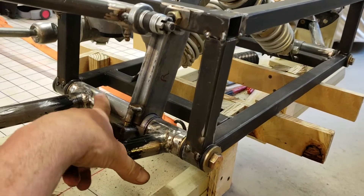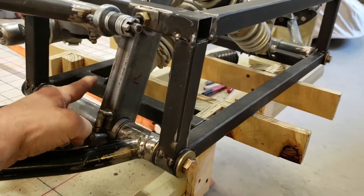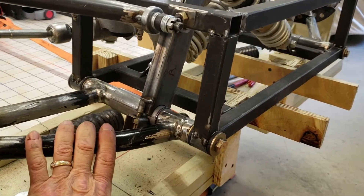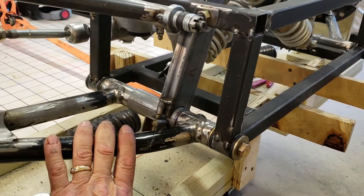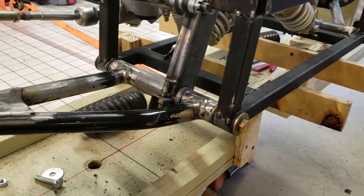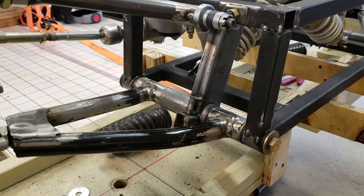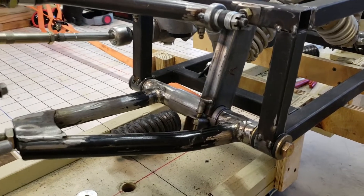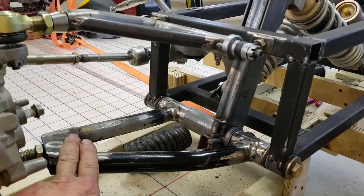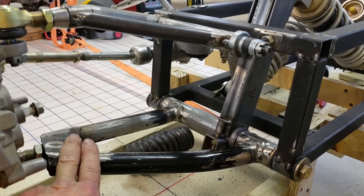It's not welded up yet, but it'll be strong when it is. There's a whole sleeve that goes on here, a brace that goes out this way, and two big 3/8 set screws set in underneath to ensure plenty of grip. There is still a lot of force in that joint. Plan B is I could put a brace from here out to here — there's room — but I'm going to try not to do that for aesthetic reasons.